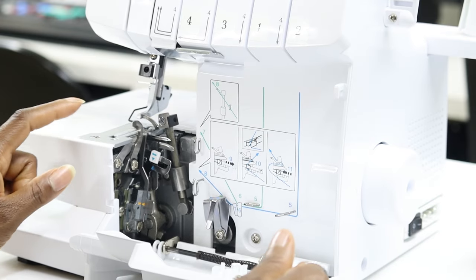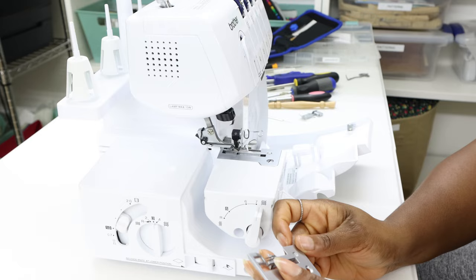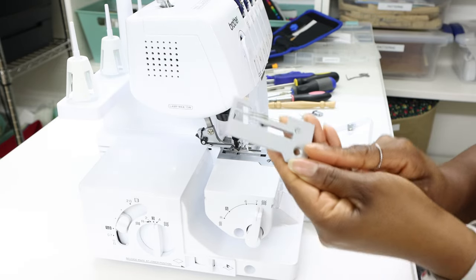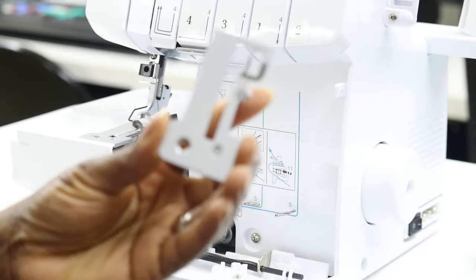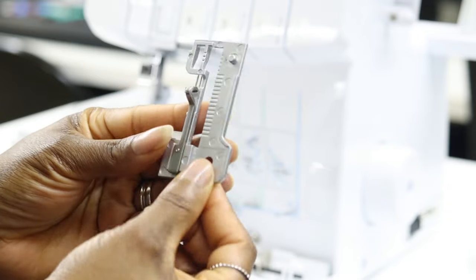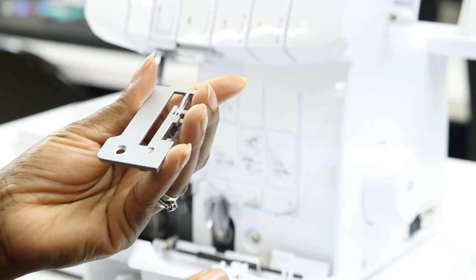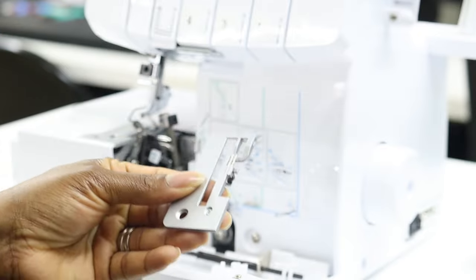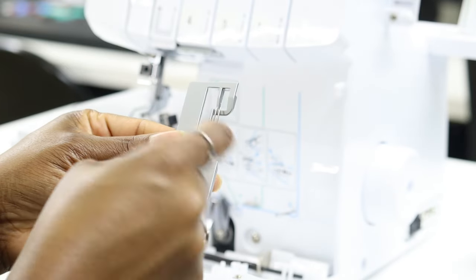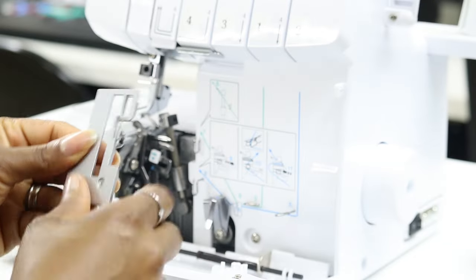Now I'm going to work on this plate here. That plate has two screws — you only want to take off the flat head screw. There is a tiny screw right here and there's actually a piece of metal attached to the back. If you make a mistake and take it out, it will just drop on the inside of the machine. Then when you try to replace the plate, the screw will just keep turning because you need that back piece. So you only need to remove the flat head.